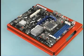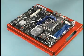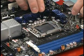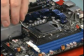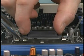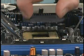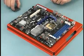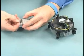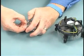To prepare the socket for the processor, the protective pick-and-place cap needs to be removed first. Unlatch the locking lever and open it. To open the top plate, push down on the tail and lift the top plate fully. Then grasp the pick-and-place cap by the two handles and pull it up carefully.